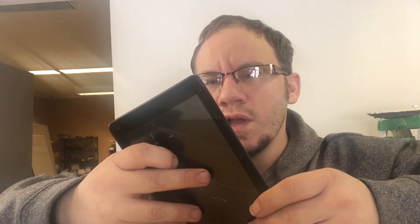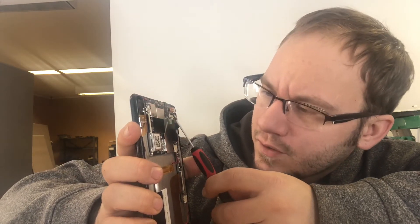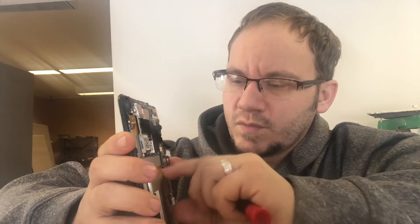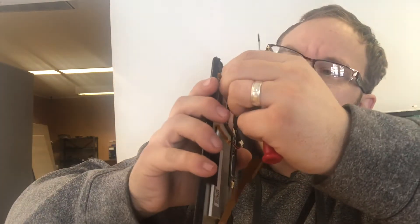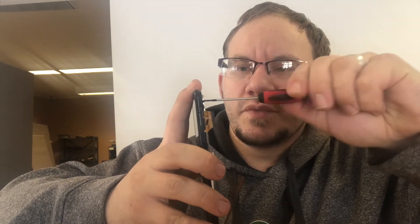So then we're down to having to gut this thing to the mid-frame, and the mid-frame on this is plastic so we don't want to put any strong pressure on this. There's a couple of screws up in here, one here, one here, and that looks like all that's holding it in. The first thing is disconnect the battery — now we know it's off. I'm gonna disconnect this — this is the LCD ribbon cable, and this one would be the digitizer ribbon cable. Then we'll take these screws out.